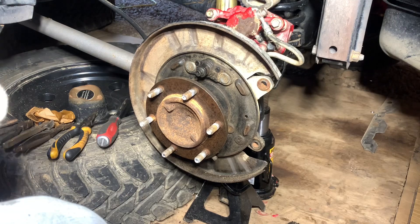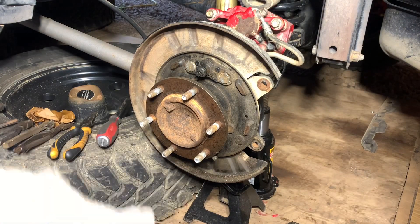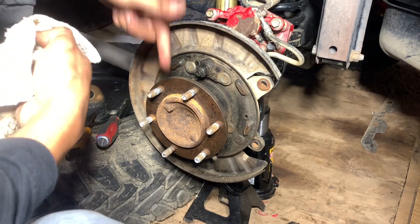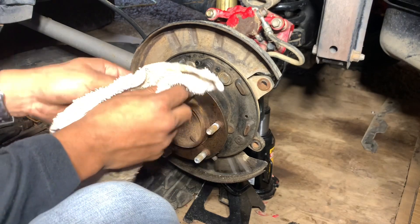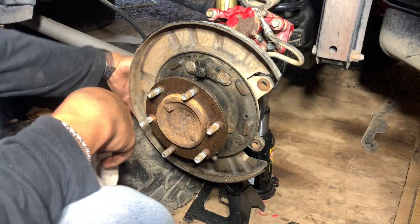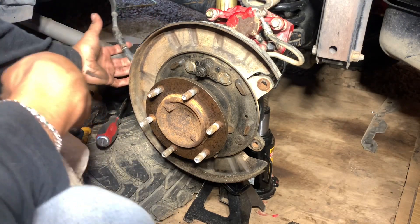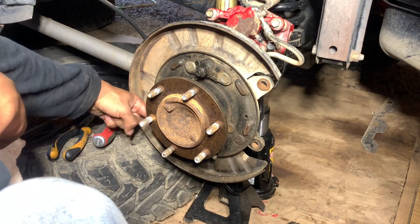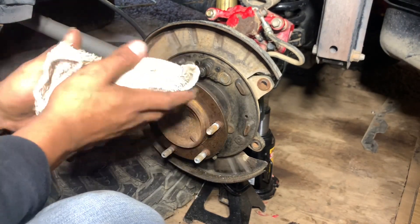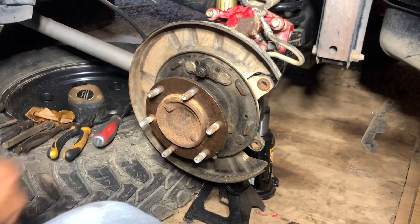So as you can see, we already got the parking brake pulled off — I sped that part up a little, it's a bit boring. Now that's off, the next step is to go behind the actual axle hub housing assembly. I still need to remove the parking brake cable from the rear, which is two 10 millimeter bolts on the back. Once that's out, it's time to undo those four 19mm bolts I showed you in the beginning, and it'll slide out.